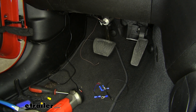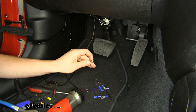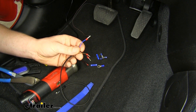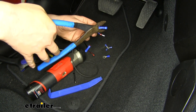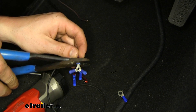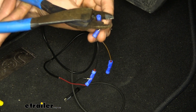We're now inside on our driver's side — we'll need to make our connections to our LED. These are the two wires that come from our LED mounted on our mirror. We have our brown wire that comes from our battery positive terminal connected to our fuse harness. This is your reed switch that comes in your kit — this is what activates your LED. We'll now make some connections to our reed switch. The black wire and the brown wire on the reed switch we're going to connect to blue butt connectors from our kit and crimp those on. Our blue wire will be connecting to the three-way crimp terminal, which also comes in your kit. The LED that comes in our kit will connect the red wire to the black wire in our reed switch, and we're going to connect the black wire to the three-way crimp connector.